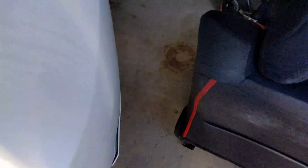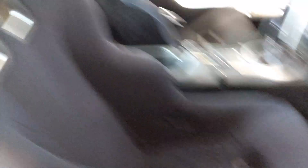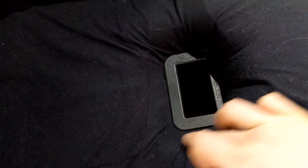As far as the occupancy sensor — on the new seat, the occupancy sensor just sits right underneath this fabric. You can actually kind of see it. This seat's fabric is already kind of messed up since these seats are from like '97, they're pretty old. I got them dirt cheap used. The sensor kind of sits in here, and there's kind of a square part, so I lined it up with this hole. And then the wire for the occupancy sensor just goes right through here.